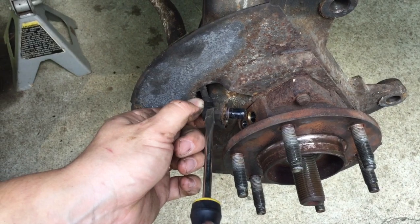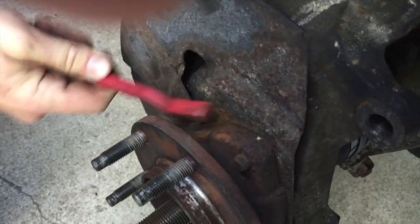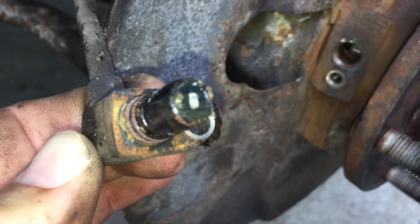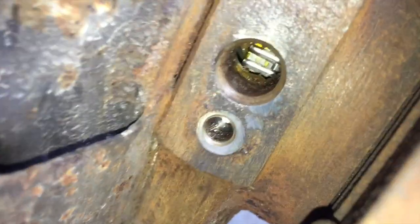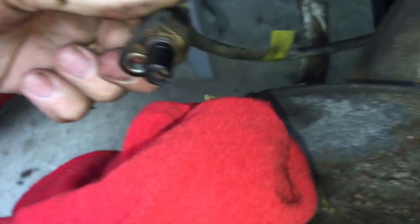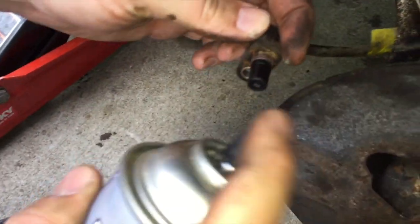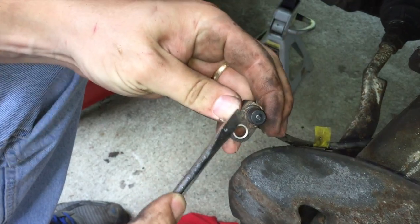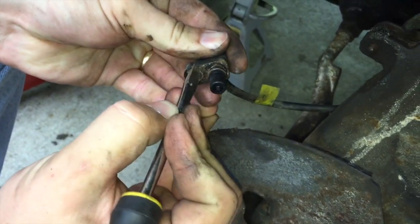If it doesn't, then I probably have a bad sensor and I'll have to replace the whole line. You can see that metal — I'm just going to call it a diode — right there in the center of that wheel speed sensor. And you can see inside here those raised teeth. As the wheel spins, that sensor picks up those teeth going across it and tells the computer how fast you're going. If that gets gummed up or too far away from the hub, it's not going to work properly. Looks like that O-ring is a little bit chewed up. This is some real light mass air flow sensor cleaner — it dries clean and doesn't leave any sticky residue.